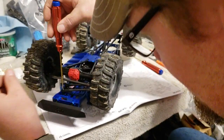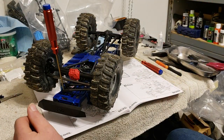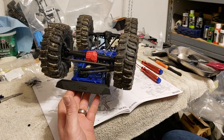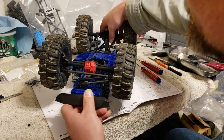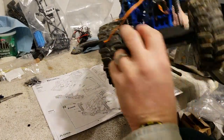The inside hole for a servo is your strongest hole - it gives you the most power for your play. But it gives you just a little less throw. If you want the longer throw, you have to go to the top servo hole. I didn't bring my flashlight in - I can't see how much that bolt's sticking through. All right, it looks like it's still clear.